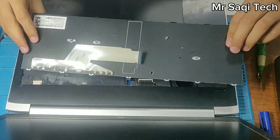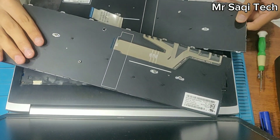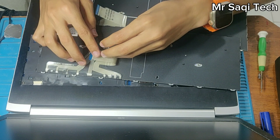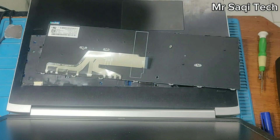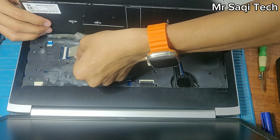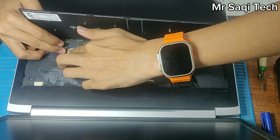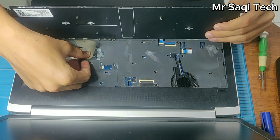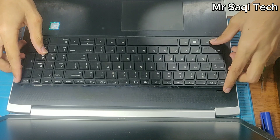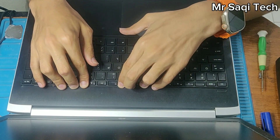So this is the new keyboard. I'm going to show you both keyboards — this is the old one. I have to fold this flex cable so I can connect it with the board. I have to connect the flex cable connector with the board, and after connecting we have to lock that connector. No need to press hard on that strip, otherwise it will be damaged. Now we can easily lock it.